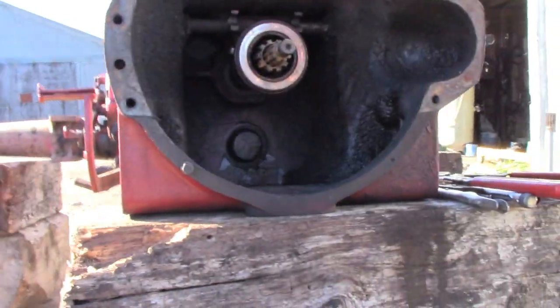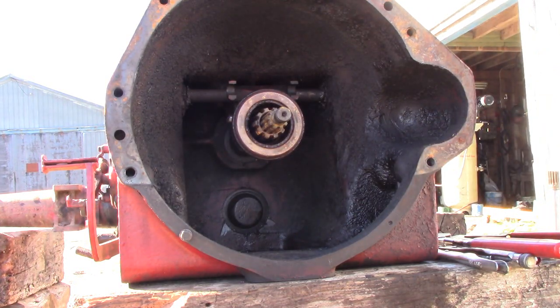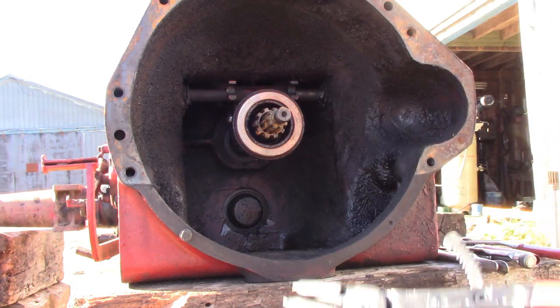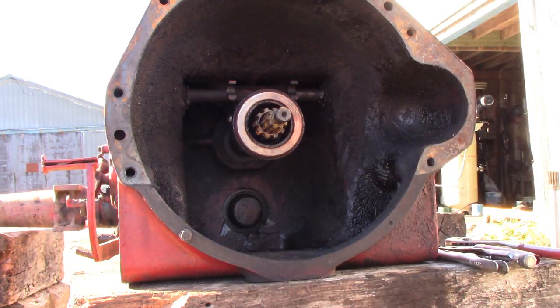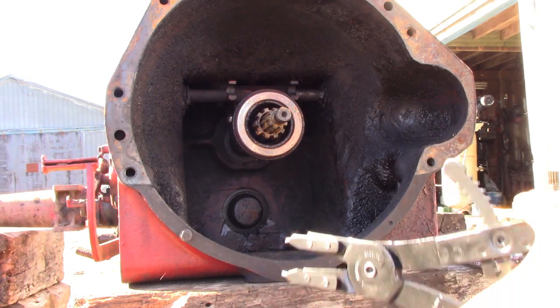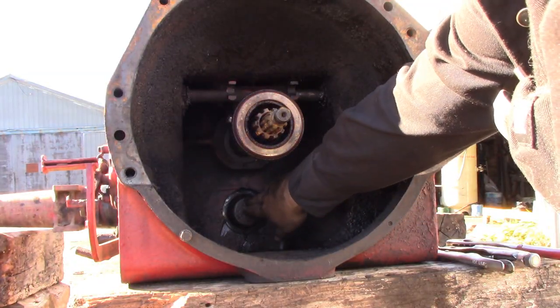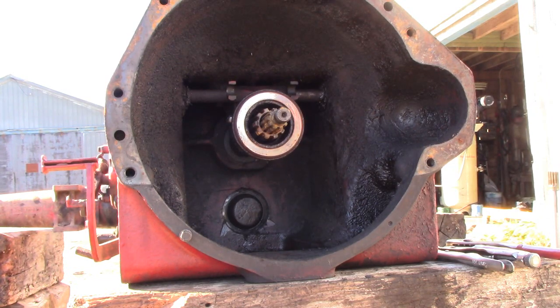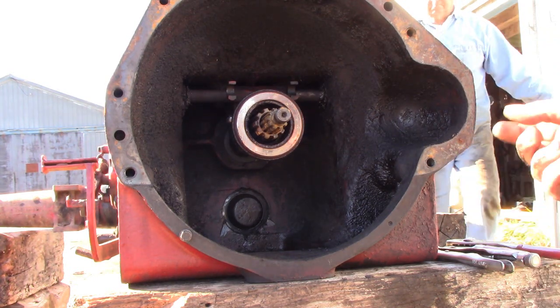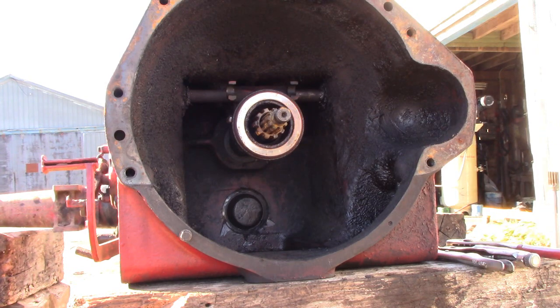Right in here, directly underneath the input shaft, there's a cap held in by a lock ring — a pretty big heavy-duty lock ring. I have taken them out before with screwdrivers and punches and so on — it's doable but it requires a bit of time and probably some foul language. For the most part these plugs are what they call a snug fit — not pressed in, but snug. It's about half an inch thick so you've got to pull it straight out; if it wobbles a little bit it'll bind and sometimes they can be a real pain.